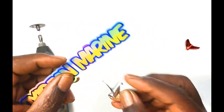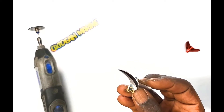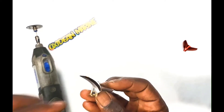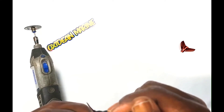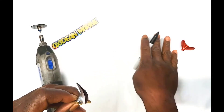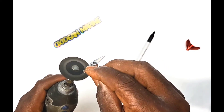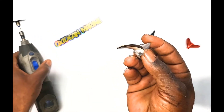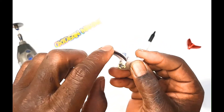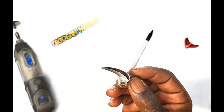You've got your Sharpie there to match it. Now, if you don't feel you cut it right or you don't think you did a good grind, you can color back over it and try it again at a different angle — a little shallower. The more shallow the angle, the steeper the cut. I cut twice so it got a little jagged there, but typically you only want to do it once.